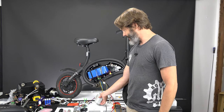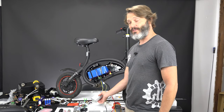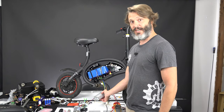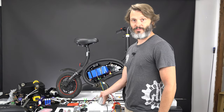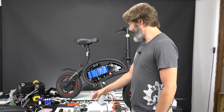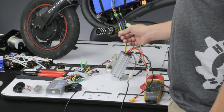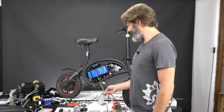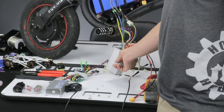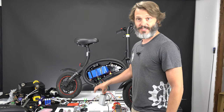What I've done is had some custom speed controllers made, and we based these off of the IRF-4110 MOSFET. These are 3.5 milliohms — about half the on-resistance of the stock controller — and also a beefier package. It's the same TO220 setup, but with a larger bus bar, basically a heat spreader, and a slightly larger overall controller size.